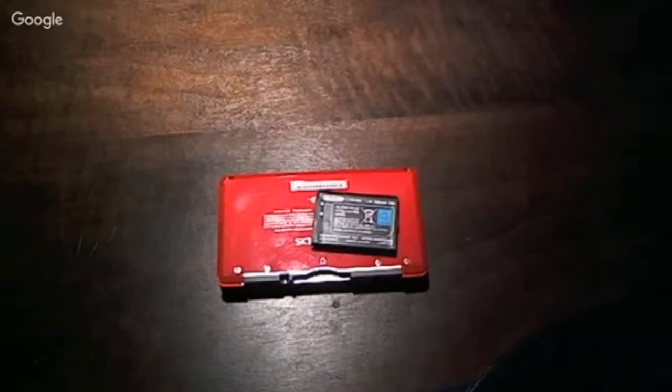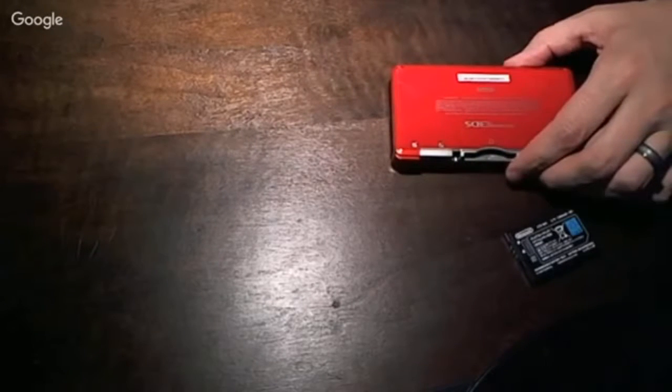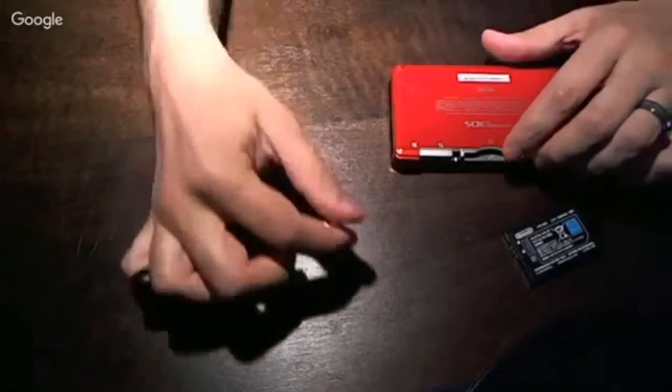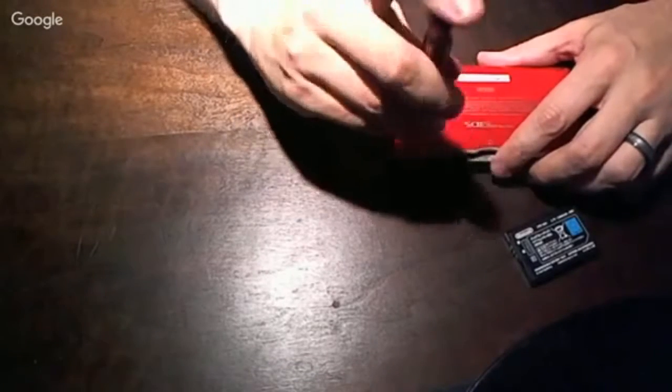The main reason why you want to test everything prior to starting, even if it's not the item itself, is if you were to damage something and cause future intermittent issues, you'd want to prove that it was or wasn't working prior to starting, like gameplay, screens, audio, not working.